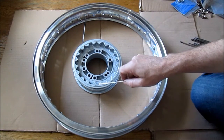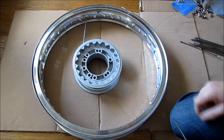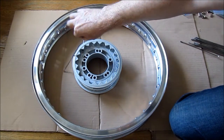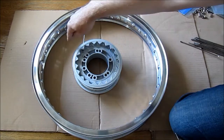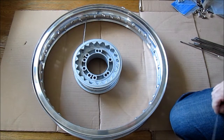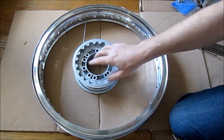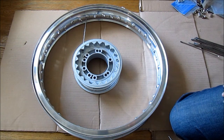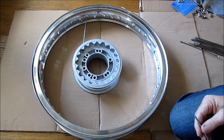What I'm going to do now is do all the inners first and then the outers. If this were a conventional hub with J-shaped spokes, you couldn't do that, because sometimes you've got to push the spoke this way before it can bend up and get level with the rim. That's fine for the first few, but when you get around to the very end, you'll find you can't turn the spokes back because the other spokes get in the way — very frustrating. To get around that problem, you have to thread all the spokes in first before connecting them to the rim. That's a bit fiddly, and you risk scratching the rim with the threaded edges.